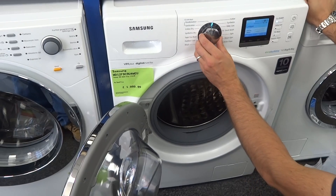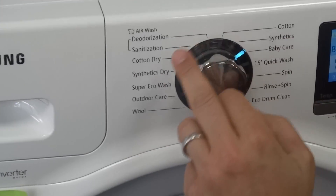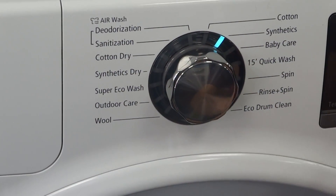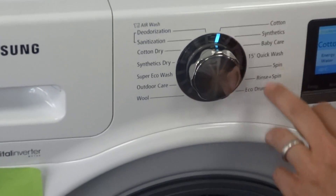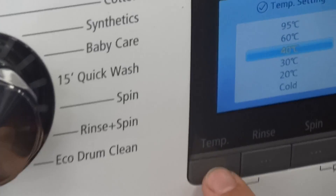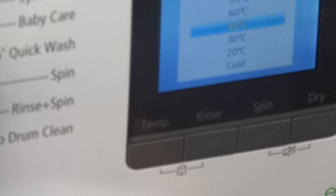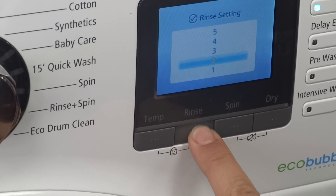Program-wise it's incredibly powerful. On the front here you select the type of wash you're doing — whether it's a cotton wash or a synthetic wash — and then inside you can actually tweak or change that program. So on a cotton wash it defaults to 40 degrees with 3 rinses at 1400 spin. If you want to change the temperature you just press the buttons up and down. If you want to change the number of rinses, you can also do that here.